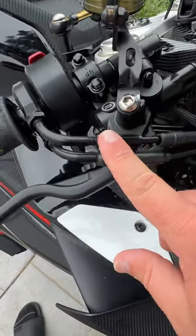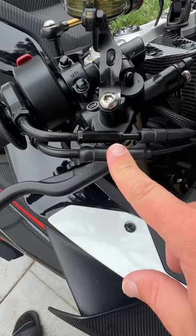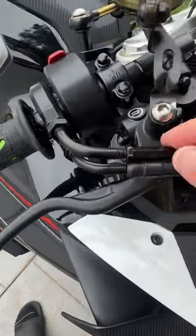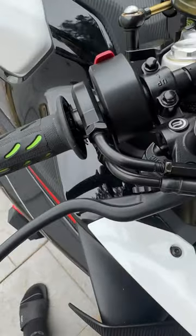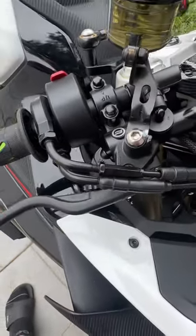Crack open the nut. Now for the 450 there's actually two throttle cables, so just do it to both of them — pull back both sleeves, crack open the nut, and then give this driver here a turn. One direction will create additional slack in the throttle, the other direction will go ahead and tighten it.